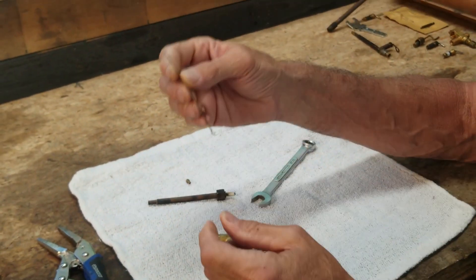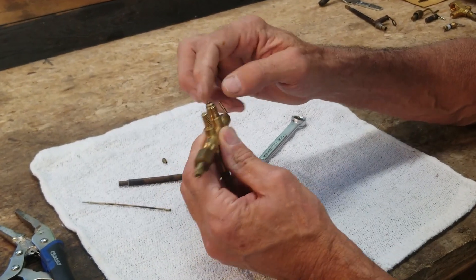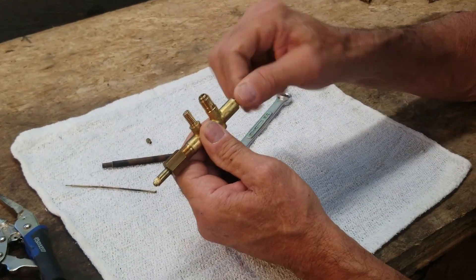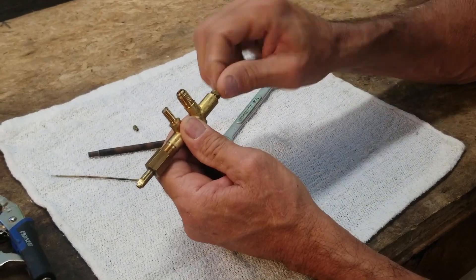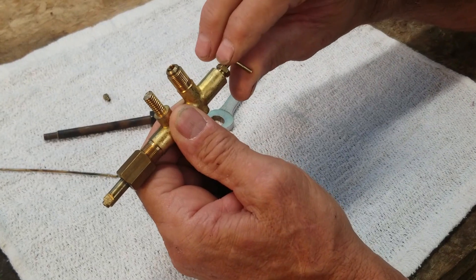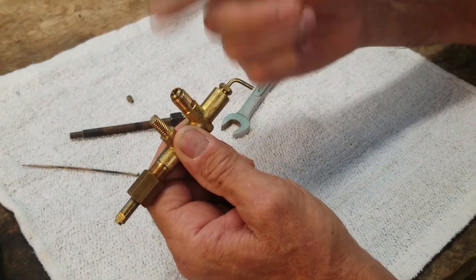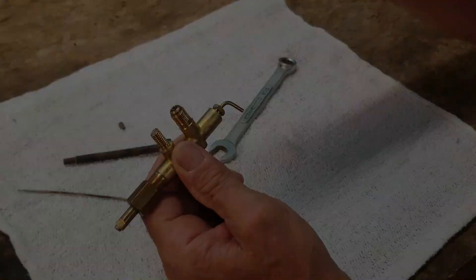To make this move, we have the tip cleaner stem and the eccentric block. You can see that's the device going up and down inside of the valve. The eccentric block turns rotational motion into linear motion, and that's exactly what this is doing. When you rotate it, it goes up and down, and that plunges out the gas tip.